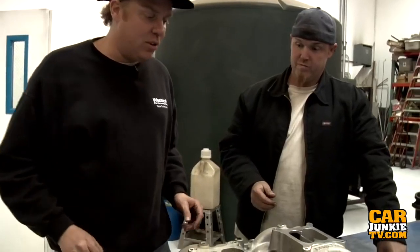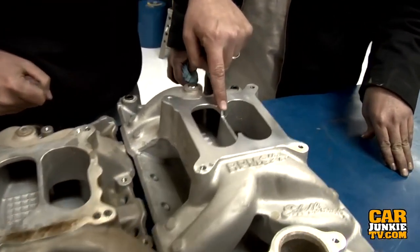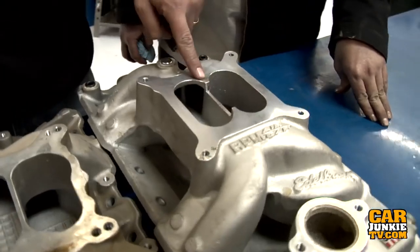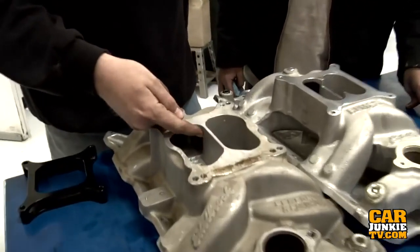The plot thickens. Being clever little gear heads, we had a look at the RPM Air Gap intake manifold and noticed that Edelbrock has split the divider wall in the plenum — and that's a factory piece. So we're going to chuck this sucker into the lathe and knock the plenum wall out of this one to see if it solves the bottom-end power and makes as much top end without needing the one-inch spacer.